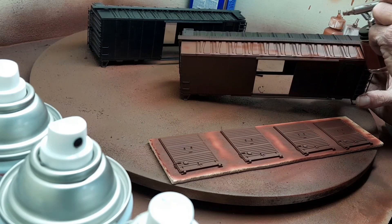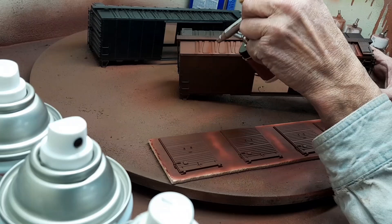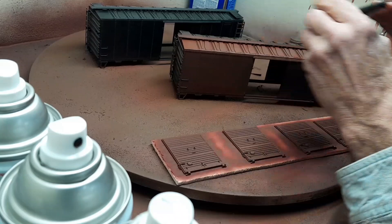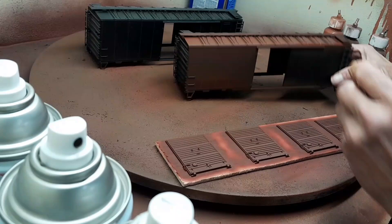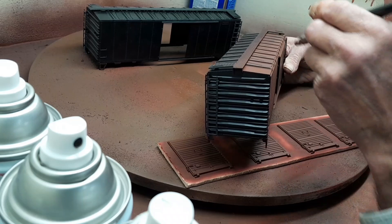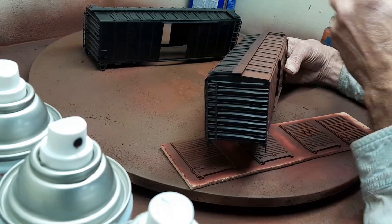You've got to make sure you go a couple of different directions to get into all the little cracks and crevices. When you spray this way you might not get part of the roof walks on the other side. You may look at it and think you got everything, but then you turn it around and you don't. Same thing here — looking down the edge of the car you can see all these fins are not painted, and that's why we want to go a couple of different directions.